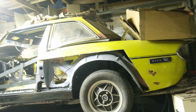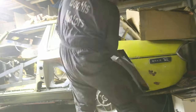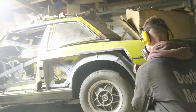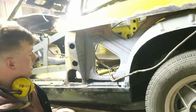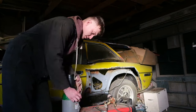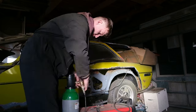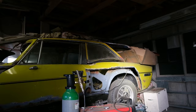Now that we're all joggled in we'll strip the paint off with the wire brush attachment on the angle grinder — safety first, face mask protection. I've got a couple of plates and I'm going to repair the bottom of the sill. I've welded it at the back. Once those are welded in I'll start getting the wing on properly. We've run out of welding gas again — here's another £58.60 hopefully lasting a bit more than two months this time. The bank account is certainly getting a little drier.